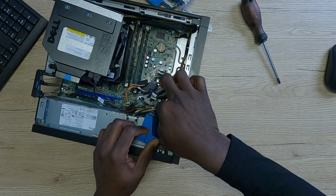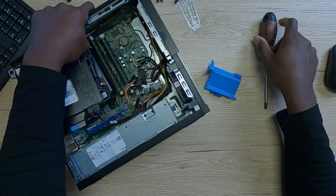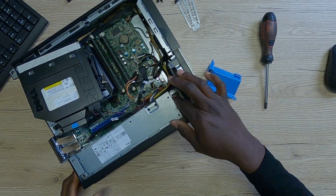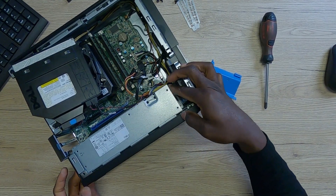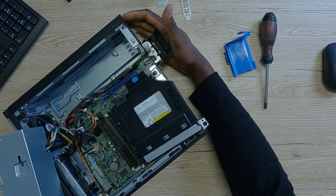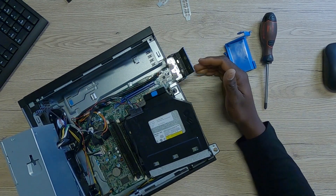If you don't bring out these cables, there's just no way to bring out the power supply. I'm going to take a screwdriver and try to depress it. This is the plastic that holds it, and if you look closely you'll be able to see the knob right there. Having depressed that, I'm going to slide the power supply out. It might be a little bit difficult, but if you're already used to handling small form factor pieces like this, it shouldn't actually be a problem.